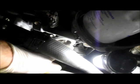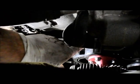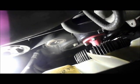Let me just show you real quick what I did here. It's a little bit difficult to see with the light, but I'll get this light down here and it'll show you. All right, so we have the belt now on the grooves down here where it's supposed to be. We have it on the tensioner down in here as it's supposed to be, around the idler pulley here, just this one here. And then we're going to make sure that the belt is on, sorry about it being so dark, on the lower crankshaft. And we're going to make sure it's in the tensioner right here with the idler pulley. The belt is on here correctly as it's supposed to, and it's on the water pump as it's supposed to. So let's start it up and make sure all your tools and everything are clear, and we'll go from there.